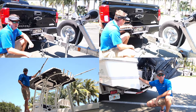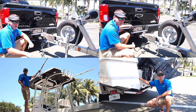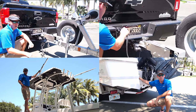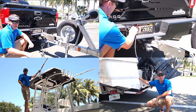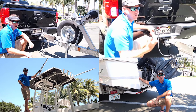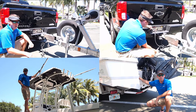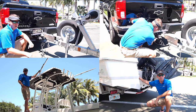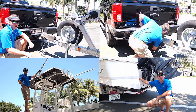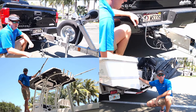You want to properly set up for trailer lights. If you have brakes, you have to make sure you have the right type of adapter on the back. This is a four-pin adapter, which attaches here to the back of the truck, and you want to make sure you have that attached. Once you're done, check the lights on the trailer to make sure the turn signals and all your lights work properly. These are your safety chains — make sure you attach all your safety chains to the back of the truck, and also your emergency brake chain as well. Now we've got all the chains secured properly.